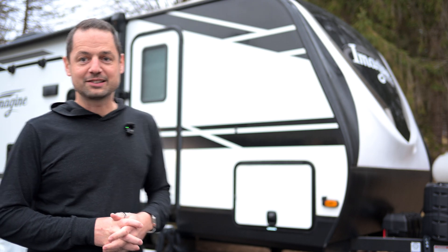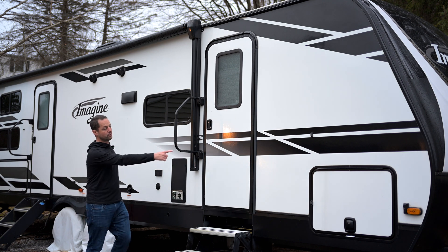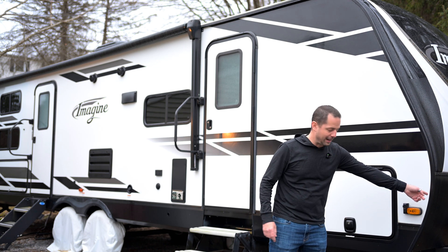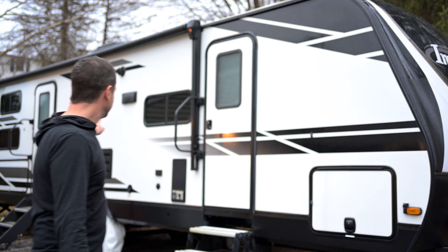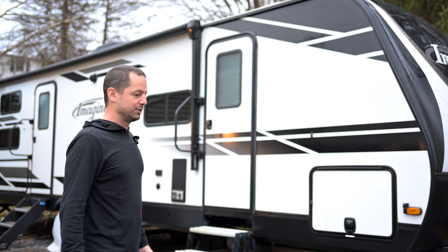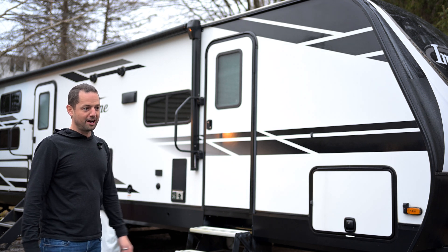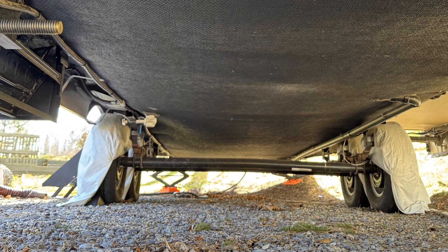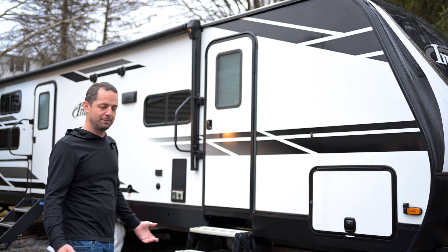The second problem was that the converter is located behind a wall. The wires run from the fuse panel all the way to the other side of the front storage where the kill switch is, and then back out to the battery. The problem is that's an eight-gauge wire, and sending 55 amps through an eight-gauge wire that whole distance isn't recommended. I was like, I've got to rerun new wire, and that sounded like a nightmare. When I went underneath to try to take the underbelly off, it's not just plastic held by bolts — you have propane screws and suspension all integrated with the same bolts.